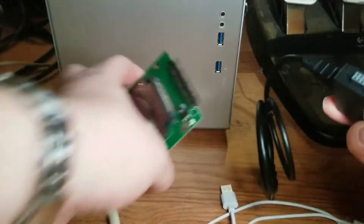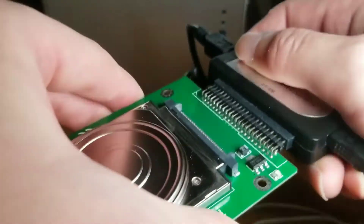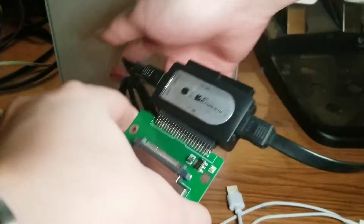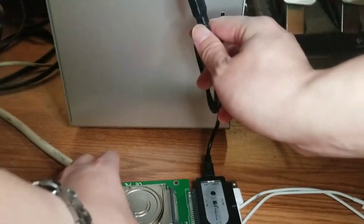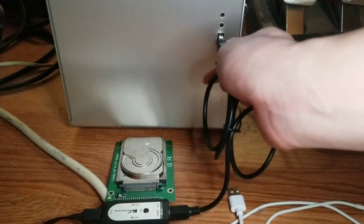This is actually the same hard drive used in the original iPods. These drives are rare and there are no SSD drop-in replacements currently being manufactured. Thus, I will be using a Compact Flash card, and I also need an adapter to go from the 1.8 inch IDE interface to Compact Flash.